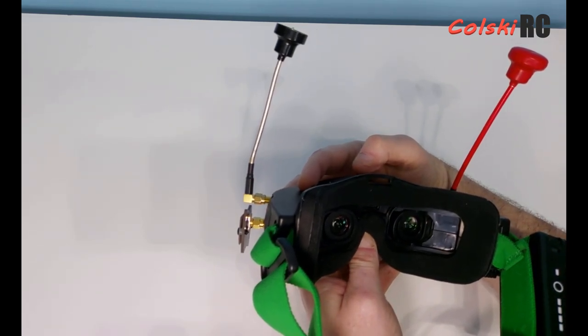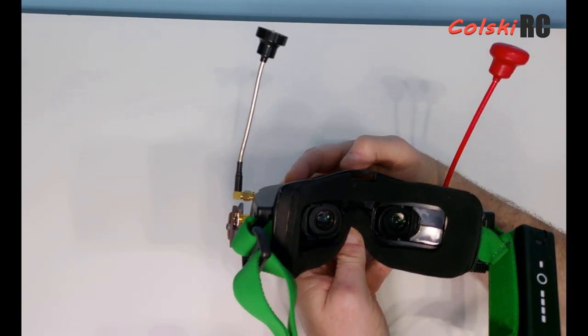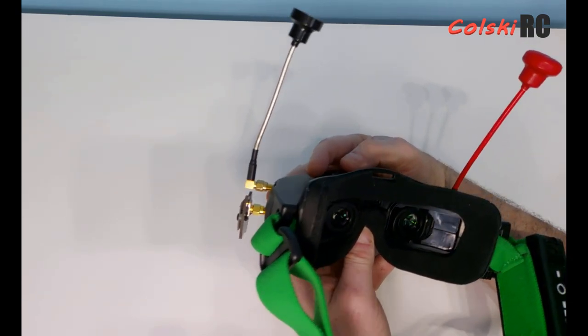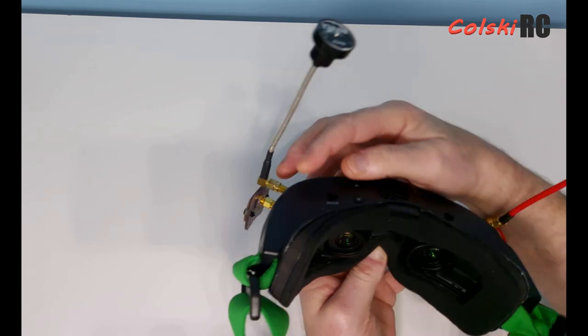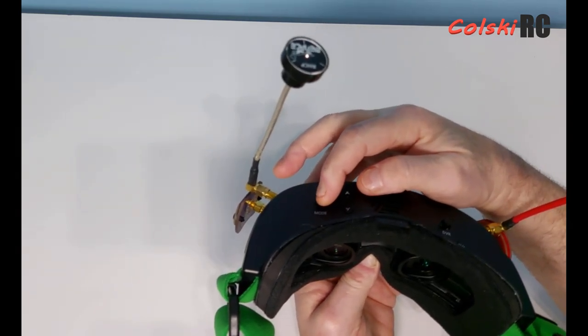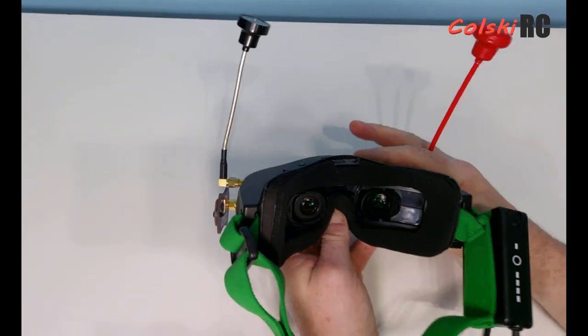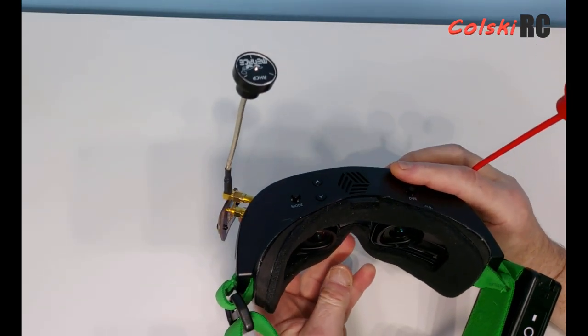And that allows me to adjust my in and out. So I can select HDMI by pressing that, or go down and swap it to AV. So it's for my input only. If you press the button and hold it and let it go when it beeps once, it will enter auto search, and it will find your 4 strongest channels.